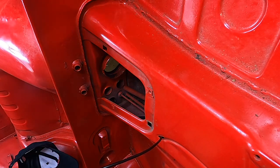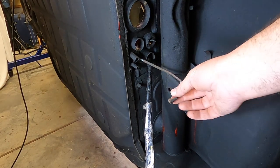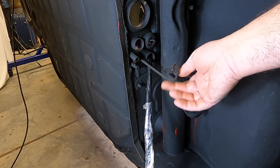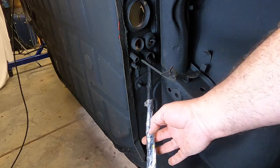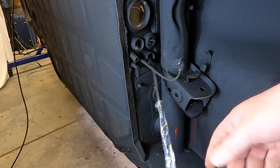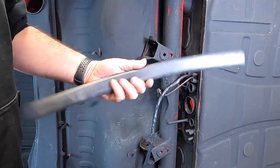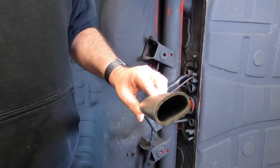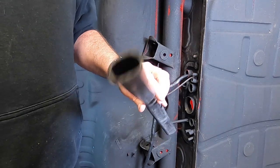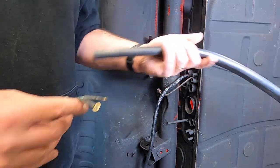The harness is through — you can see it coming from the other side. There's a brake line still on this car, which is about the only part remaining. Next, you need to feed the secondary sheathing onto the harness. Put a little baby powder inside to make it slide easier — otherwise it grips the harness too much and is too hard to pull through.